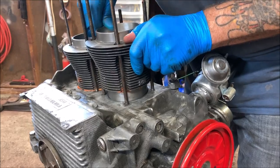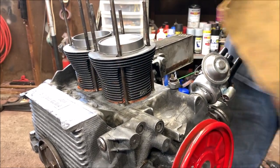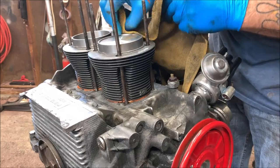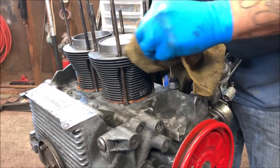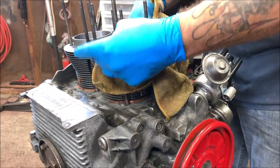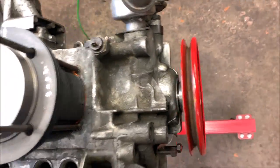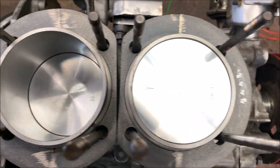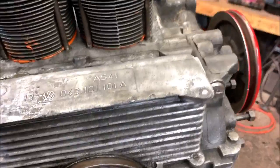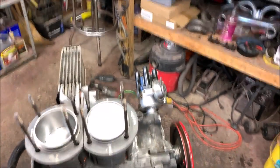Take your time, move slow, never rush. Clean up the mess. Back in the day they used paper gaskets; I use ultra copper. Some people use gasket cinch, some people use other things. Use what you see fit, don't nail me for what I use. Flywheel side — the arrows are pointing to the flywheel. You can see the sealer squirted out a little. I'll clean up the messy fingers later, not a big deal.